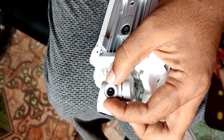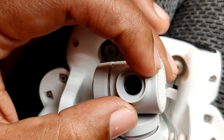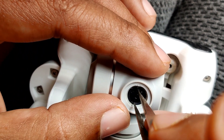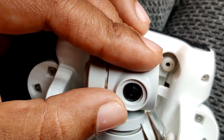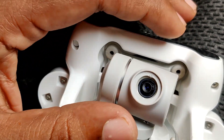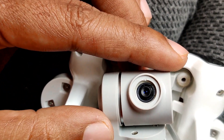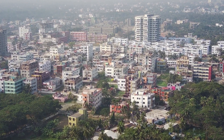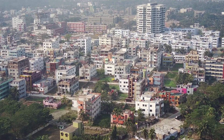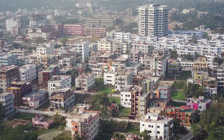Step 2: when you remove the camera lens glass, you need tweezers to rotate the camera lens focus. It's a little bit clockwise. If you have a right or left side out of focus issue, just rotate the lens clockwise 5 to 10 degrees. If that doesn't work, rotate a little more and check the quality, then check it again.